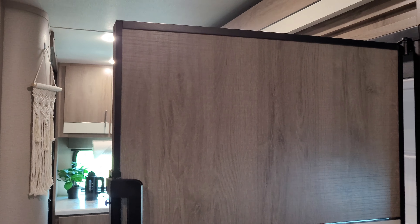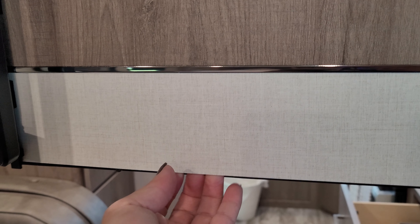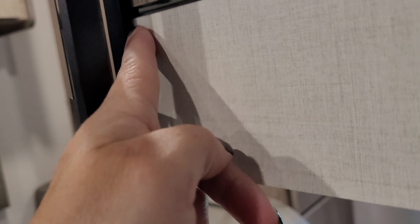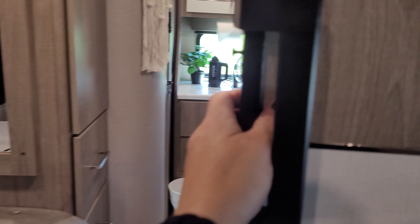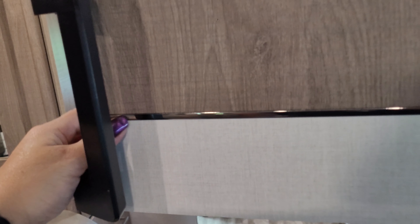Freezer is done. One other tip I didn't run into on the fridge: when you're sliding the panel back in, I kind of hold it out so it bows a little in the middle. When you get to these silver strip parts, the latches on the handle are super tight, so it kind of catches on the metal strip. So make sure your handle is not all the way tight, and just press in on the panel as you go to get it past that little metallic strip.